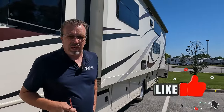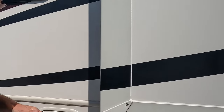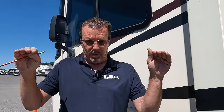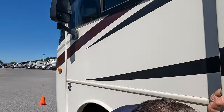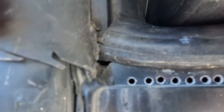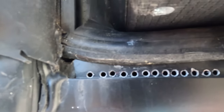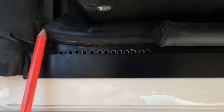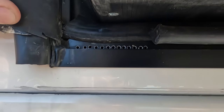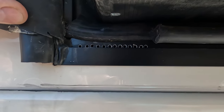If you want to sneak something, you've got to be careful — consistent and make it look professional. The sad part is it's kind of obvious when you see it. Right here I've got a bunch of little holes that were drilled in there. I actually had to cut this bulb seal in order to allow the slide out to go in and get the water out of there.